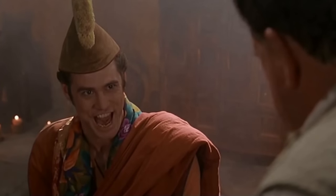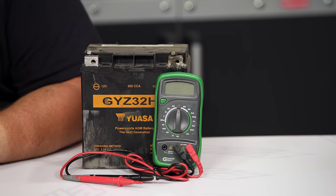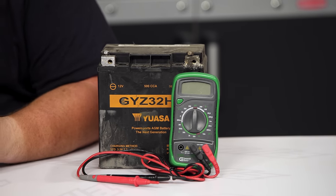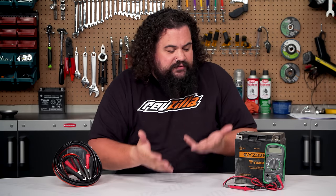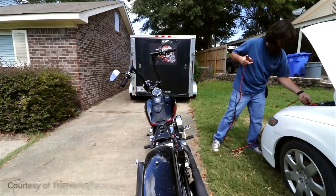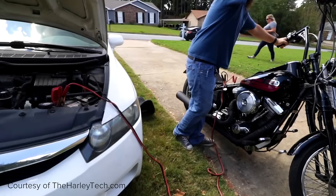I can make this actually a really fast two-minute lesson. Yes, you absolutely can do that. As long as you're jumping a pair of 12-volt vehicles that both have negative ground, the process for jumping a motorcycle and a car is exactly the same as it is for jumping a pair of cars or a pair of motorcycles. The batteries don't care. The different size between the batteries doesn't matter. Your motorcycle is just going to use whatever it needs from the car, and that's it. It just works.